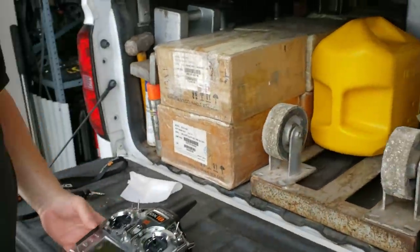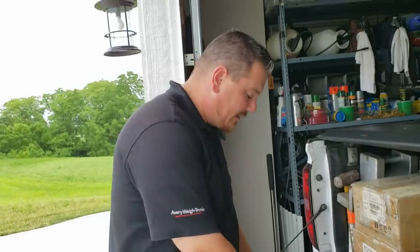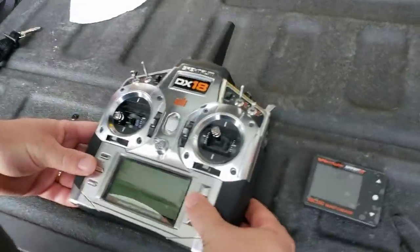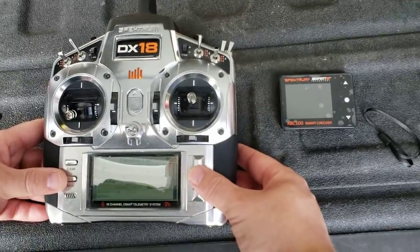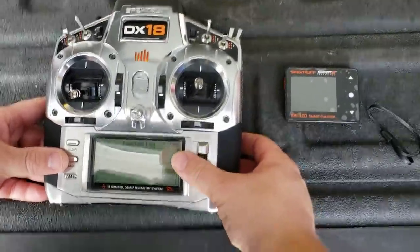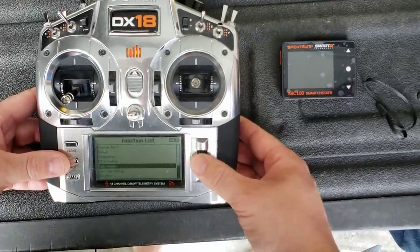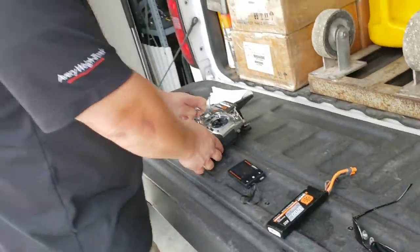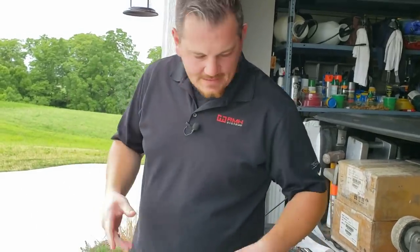But you can still use that master gain control if you need it. The master gain control is the only one I know of right now that's actually doing anything. Okay. What I want to happen is I want to be able to turn up the gain just a little bit more when needed. Mm-hmm. So if you go into the forward programming or, yeah, see, I don't see it because I don't think you have to be actually plugged in. Because when you're forward programming, you're actually programming the plane via the remote. So when you see that, that's what it is.